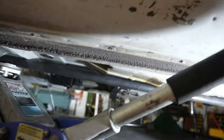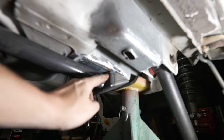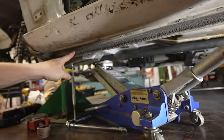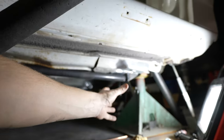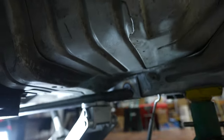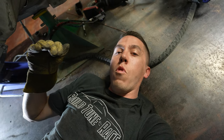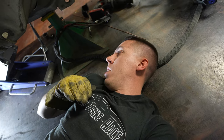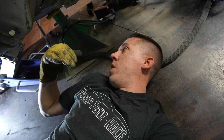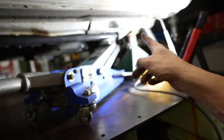Back here, it ended up sitting further back than I thought — the piece kind of rotated, but I just threw a tack on there to hold it. Once I get that side tacked and everything's nice and tight, I can rotate that little back mount and put a tack on the bar to locate it. Welcome to uncomfortable positions to weld in — we got a few tacks on there so it won't go anywhere. Now I can slide out of the car and rework that spot. This install would be pretty decent on a four-post lift, except for the floor jacking and notching parts. One side is fit up and tacked — I'll cut the tacks on that side, drop the bar out, and fully weld it up on the outside of the car.